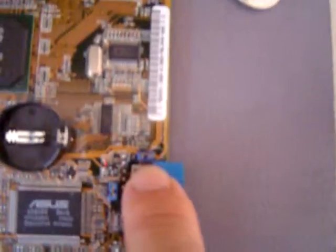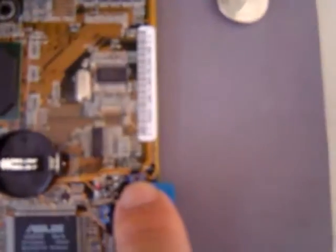When you get the motherboard, or when it's brand new, you'll see it all the way on the right side here. There's a 3-pin BIOS jumper. You'll see it on the right side. Take the battery off. Go ahead and pull it out and move the jumper to the left side, count to 10, count to 3, whatever. The minute you do that, it's clear. That's basically it. Put this back on the right side, put the battery back. I'll do it real quick. There you go.